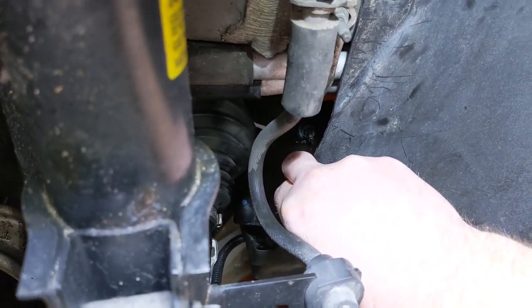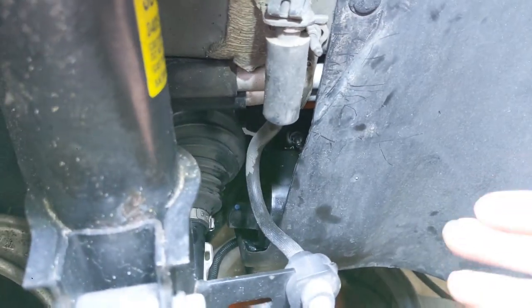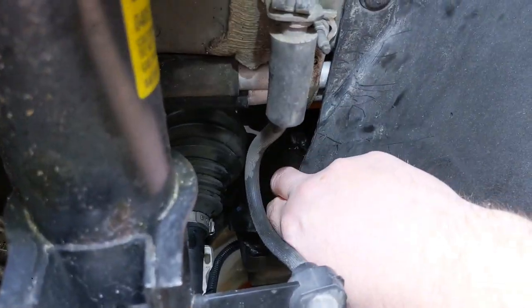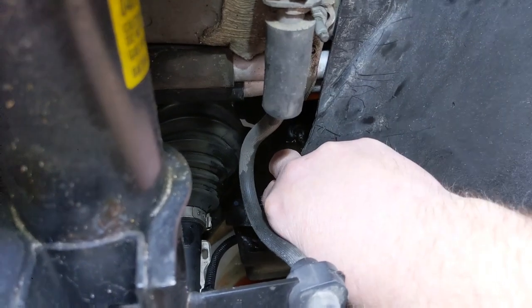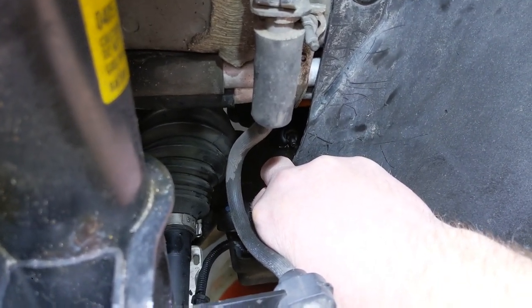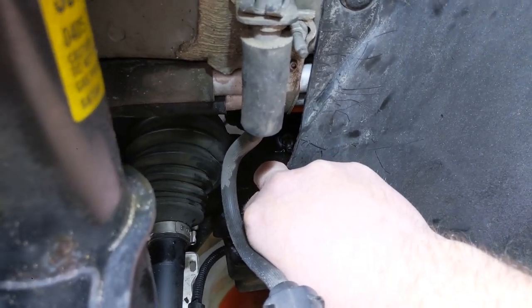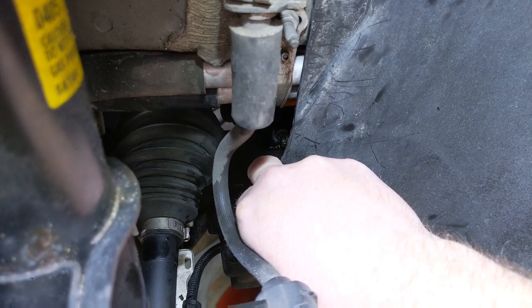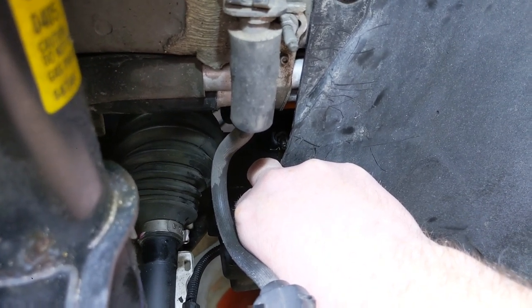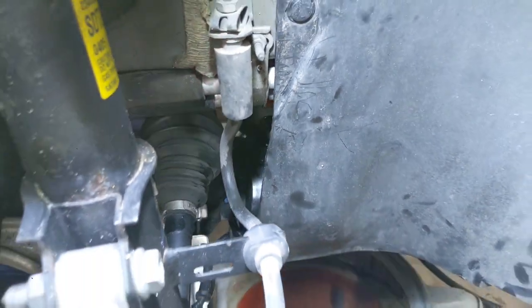This pump actually has a lot of vibration when it's on, and that's why the manufacturers put it inside a rubber dampening device to keep those vibrations from echoing down the frame. So reach in there with the heat on high — if you don't feel that pump on, you probably have a faulty pump. If you do feel it pumping and you saw a kilowatt spike on your dash, you can say your pump is good and your heating element is good. In that case, it's probably the valve that controls all of this that's your faulty part.